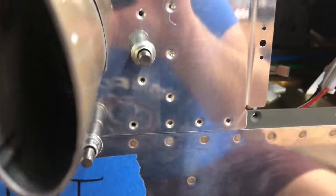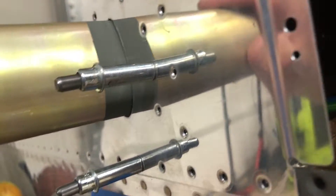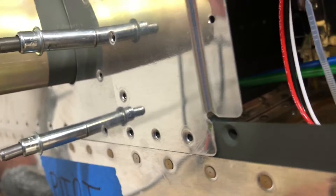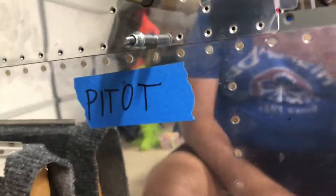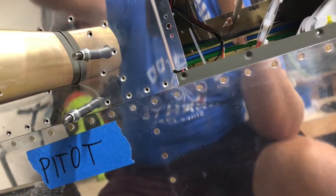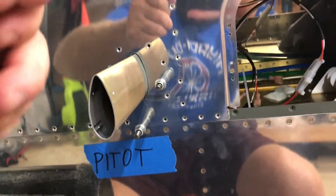The fit is great. I only primed about one inch of this because when it gets final painted I just wanted some protection where it matches up — where the exterior paint won't get to. To get this in, all you do is slip it through the skin first, and then when you're dropping the skin from the top down, you just bend this forward a little bit and it slips right into the channel.